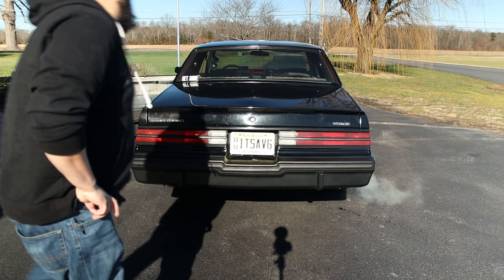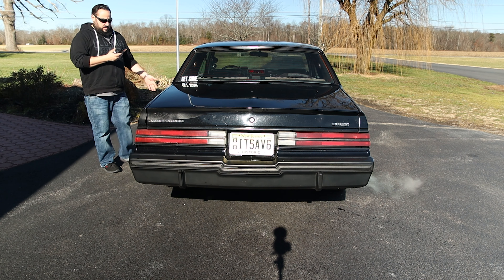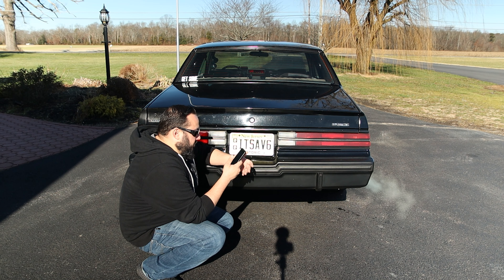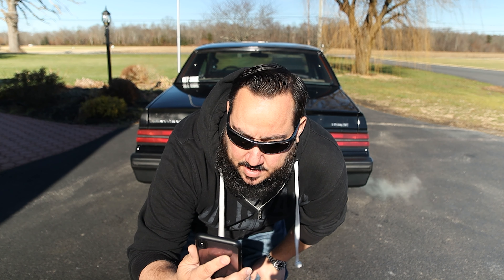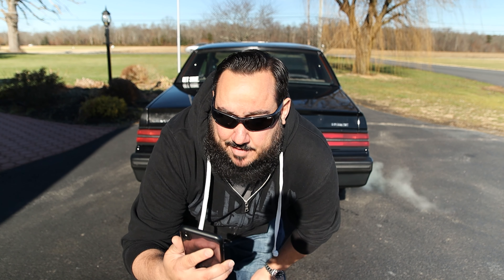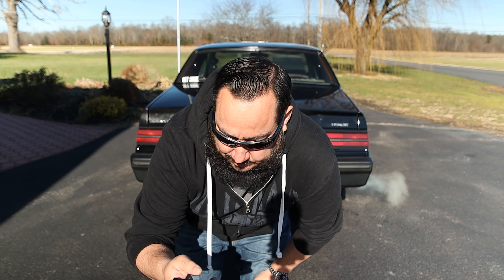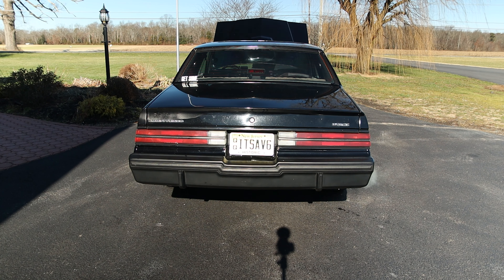Malfunction code 15 — let's look that up. It's telling me coolant sensor circuit, so I'm going to pop the hood and take a look at that and monitor the temperatures while it warms up, because I've never had to throw this code before. Maybe the sensor went bad — I'm not sure.